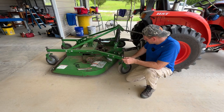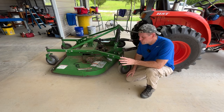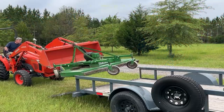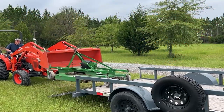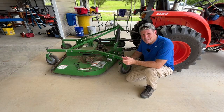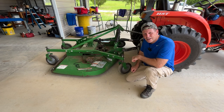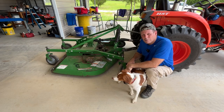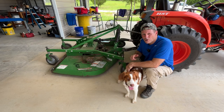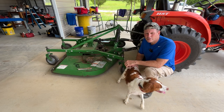One thing I have to do is put in a new grease fitting. When I was unloading it from the trailer when we first bought it, I got on some uneven ground and it slipped a little and the bucket actually broke off this grease fitting. But luckily it came right out by taking a little screwdriver and just turning what was left of it out. Now I'm going to put this new one in and also talk a little bit about John Deere and proprietary parts, because this is the first John Deere piece of equipment we've bought out here at Piney Grove.